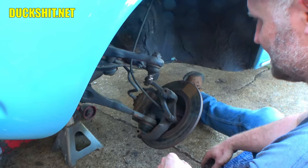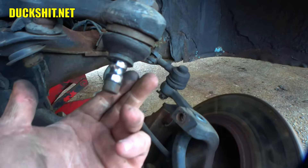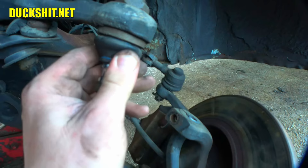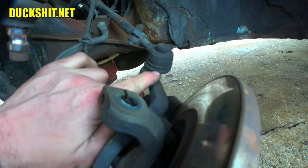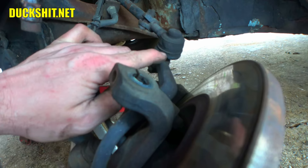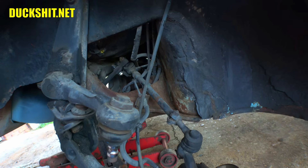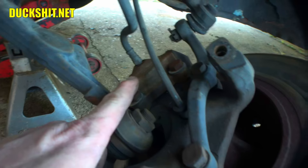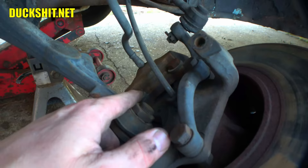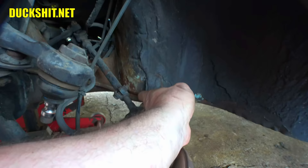We need to loosen the grub screw up under here. Looking at the ball joint — it's actually brand new, nice rubber with no dry rot or cracks. Looks like somebody replaced both ball joints on this side at least. The tie rod end however leaves much to be desired — it's split, completely shot. I'd replace the entire tie rod. The caliper looks fairly new, just a light dusting of rust. The rotors have some wear and I can feel the lip — these might be original.